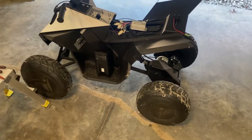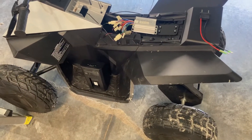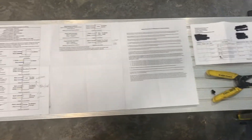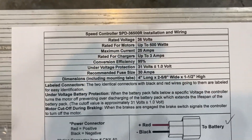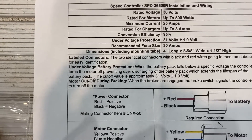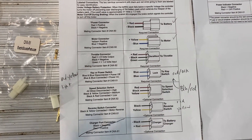Here's what we're looking at today. It's a Tesla Cyber Quad that did not have a motor controller in it. We started tinkering with it to see if we could get it back up and running. After a bit of research I found a pretty good fit from electricscooterparts.com — the SBD365WR motor controller. It's got reverse functions and it's rated for a 500 watt motor, so it's plenty big. I was pretty confident it was going to work.